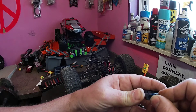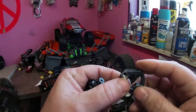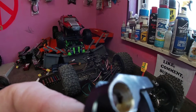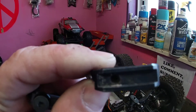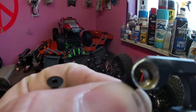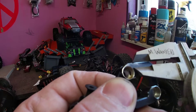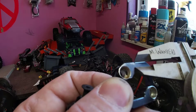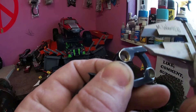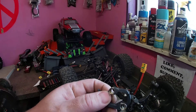So that worked, except now the bolt won't fit in there. We had to counter-bore it out to take that bigger 1024. But here's the problem: this is a normal hole and this is your mesh hole - the bolt that screws in to set your mesh. We drilled this hole out so much bigger that the counter-bore broke into the side of those threads, so I only had maybe that many good solid threads left.